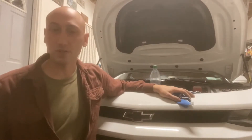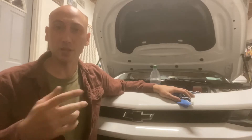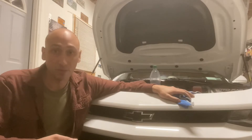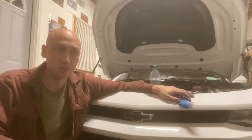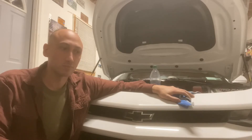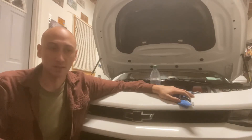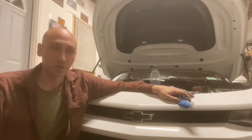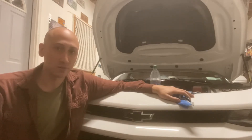What it was doing, as you heard in the first video, is making that loud — not supercharger whine — but almost like a bad power steering pump whine, and it was doing it really bad, it just didn't sound good. Sent it off to Kong Performance, they rebuilt it in a couple days, got it back, put it back on, and everything is good. I'll put some pictures in here of how it worked out and I'll talk about how to take it off and put it back on.